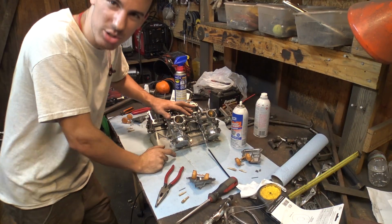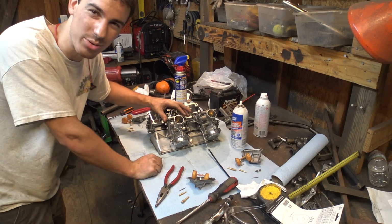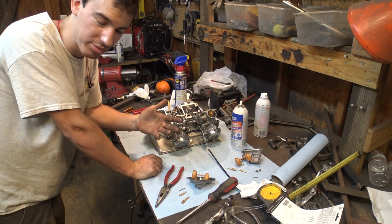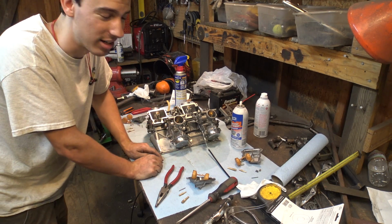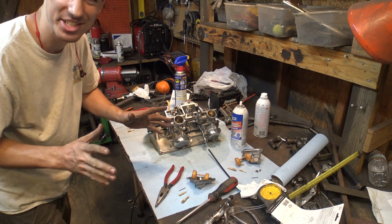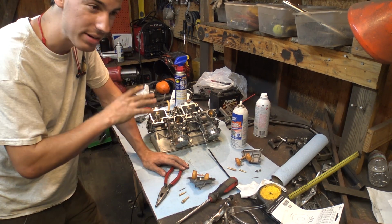So, I did have to clean the carburetor after driving it. The last few hours of driving it off-road, it was running really poorly. It kept dying every time I let off the throttle. And it was only idling on 2 cylinders. I was really nervous at first that I broke it. But after bringing it back here the next day, I checked everything.